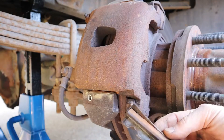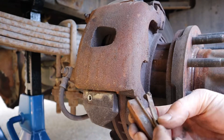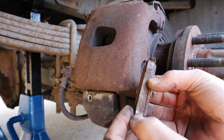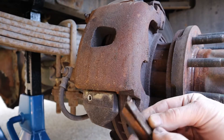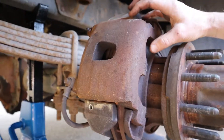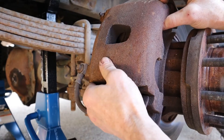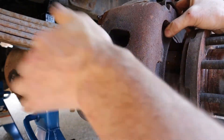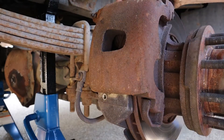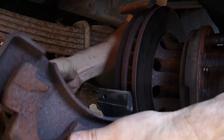You can see this surface right here — the brake caliper should slide against this, and it also slides on the top of this spring. You can see how rusted up and rough that is, and there's absolutely no grease on there. It also has a friction point up here at the top that is rusted. Once you get that out of the way, the brake caliper should come down and you should be able to rock it right off.